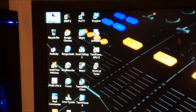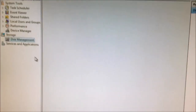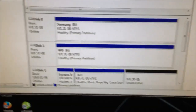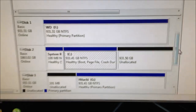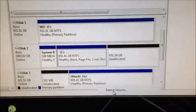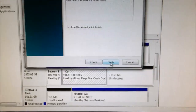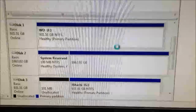It booted up onto the cloned Toshiba drive just fine. It still says I have a terabyte, so what we're going to do is expand that. Let me go to manage here — Disk Management. As you can see, there's a lot of extra space here, so what we're going to do is extend that. And now I have 2TB of space on my boot drive.